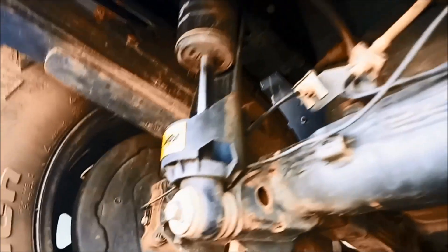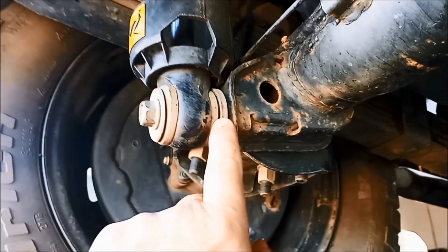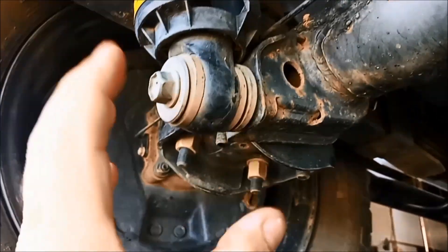While you're under it, good idea to just check everything — make sure there's no oil leaks, transfer case, universal joints on the tail shaft, centre bearing right back down to the diff. Just make sure there's nothing out of whack or obvious. One of the telltale signs if these bushes are worn is it'll have a clean mark there where it's moving around more. Just a little hint there. It looks pretty dry under here.